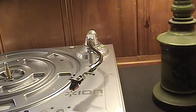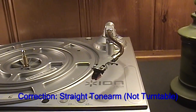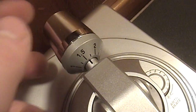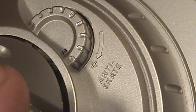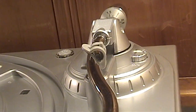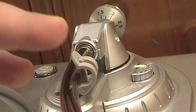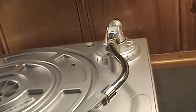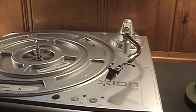It's a nice change that's definitely reminiscent of the older Technics model turntables that everyone seems to want. Unlike the AT-LP60, this unit has a counterweight — very nice to see. Another bonus is the anti-skate control present on this unit. I finally figured out how the locking mechanism is supposed to work; it was actually bent beyond the point at which it's supposed to stop. I fixed that and it does a good job locking the tone arm, so I won't need to worry about it swinging around and ruining the stylus during transport.